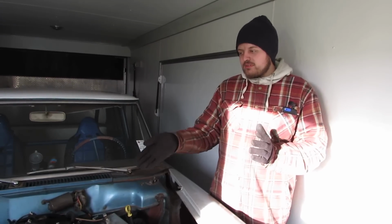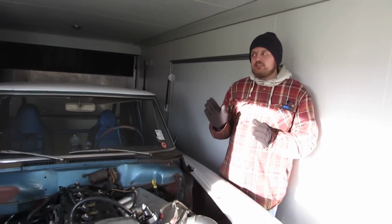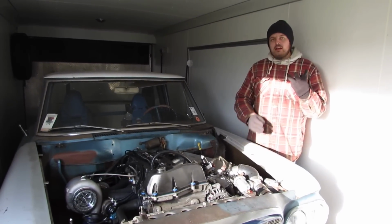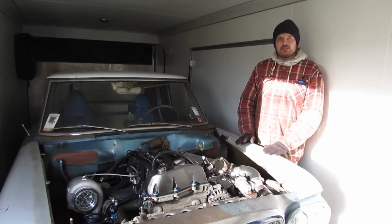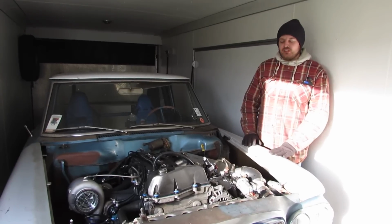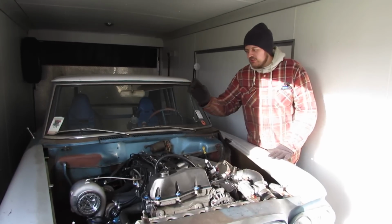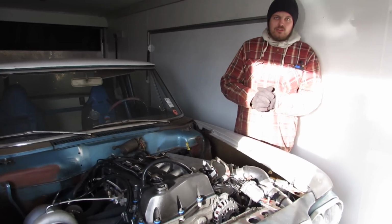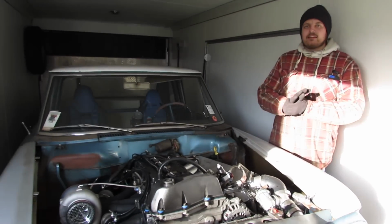With the ability to read back pressure, we could very clearly see exactly what was wrong, because in that 3 psi of boost increase, our back pressure increased by 8 psi. So very clearly it was like, nope, turbo's done. That is it. Turbo has no more to give. So that sort of leaves the question, I just mentioned that this pressure sensor is reading inside of the exhaust ports, so is the head out or is the turbo out?